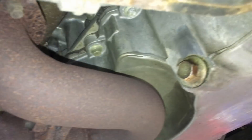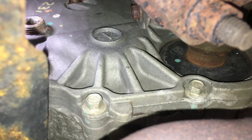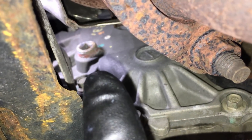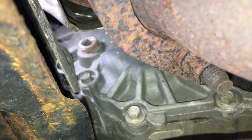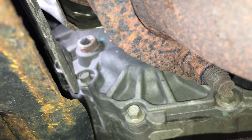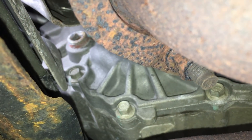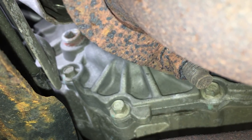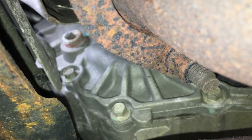It's buried in here — here's the engine, transmission, and here is the cat right there. All that is wrapped around the PTU and the fluid is just baking in there. Now you see that fill plug right there? Well, there is no drain plug, so we're going to be using the fill plug for draining and filling the PTU. That's another reason why you want to change it every 30,000 miles, because we're not going to be able to do a complete exchange.